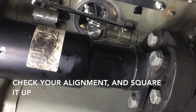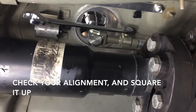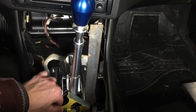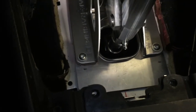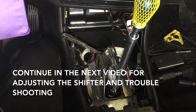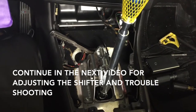With the transmission in neutral, go ahead and go to your selector rod underneath the car and break it loose — just enough to make a very small rotation to center it up and make everything aligned. After making just a mild adjustment, we can see that our shift lever is pointing straight up. The selector rod is still in line with the drive shaft and going straight to the transmission — everything is still centered up. Essentially, what we are going to be doing is establishing your default or center position, and you are doing this by synchronizing the shifter with the transmission.